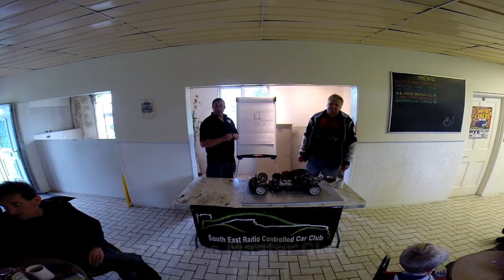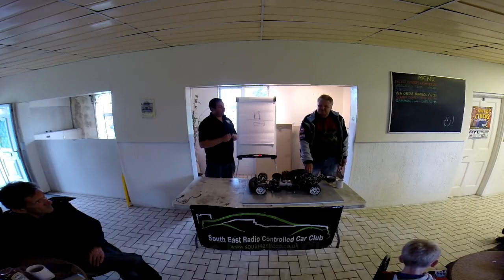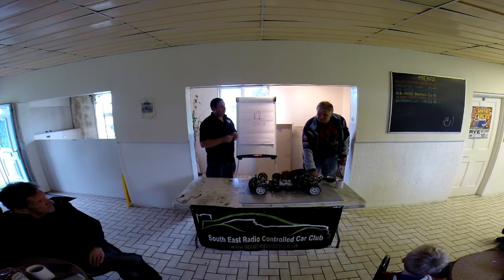And is it basically very sticky, but the tyres are just delaminating, sort of skinning over the top, is that what's happening? When you get too hot, there's two things that can happen. In Formula 1 they call it graining. I call it shredding, basically. What you do is actually start rolling the surface of the tyre, and the instant you do that, your grip falls off massively, because you've no longer got a nice smooth surface gripping the road.